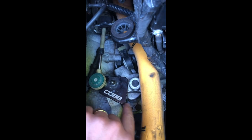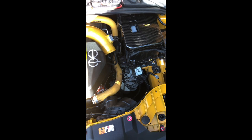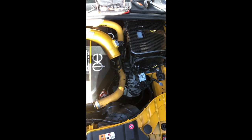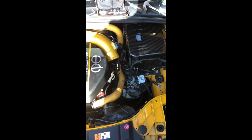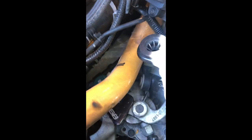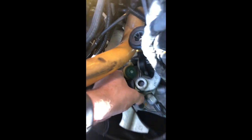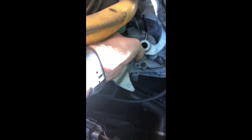Once we get that out, we can take the swing arm off and fit the new one. I managed to finally get that split pin out — I had to use a little bit of WD-40 to loosen it up. I used that Allen key and a hammer and managed to get it pretty much all the way out. A few light taps on top of the stock swing arm to release it from the transmission, and there we go.